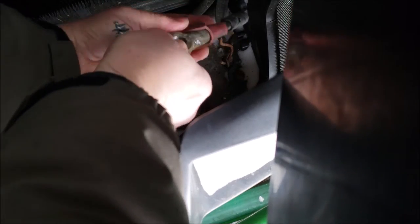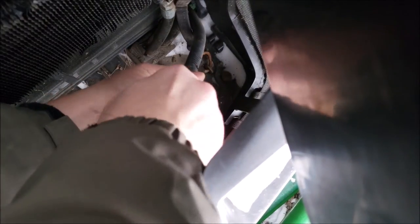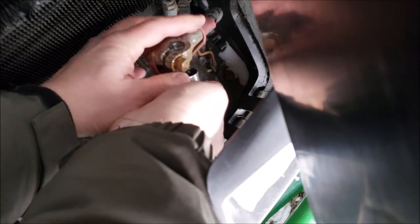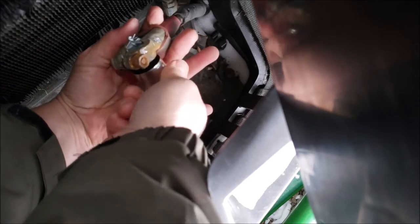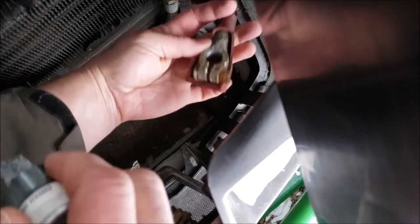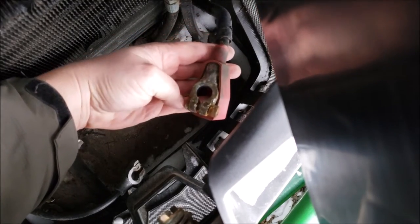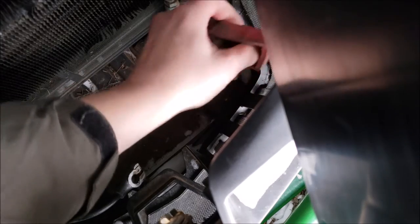If it only cleans a certain amount, you've got to do more. I'm going to go from the other side and scrub at an angle to get it nice and cleaned up, because good contact means happy, long starting times. Corrosion can cause issues as well — make sure that's all cleaned out. Things that concern me: the rust. You can put motor oil or grease to cover that up and keep it from rusting. The rust is generally from the acid in the batteries.